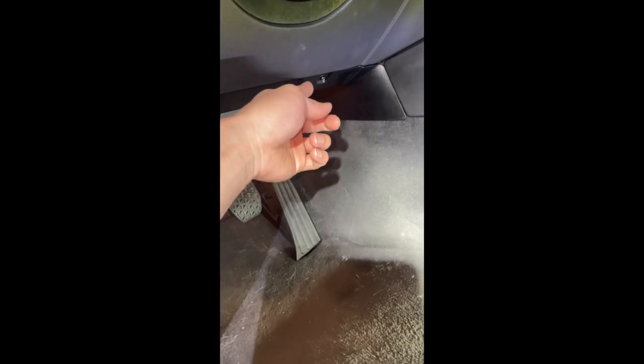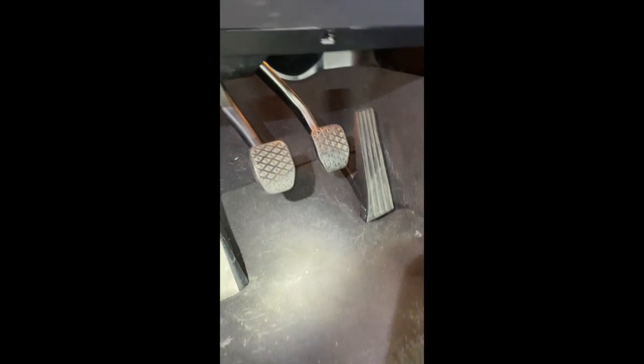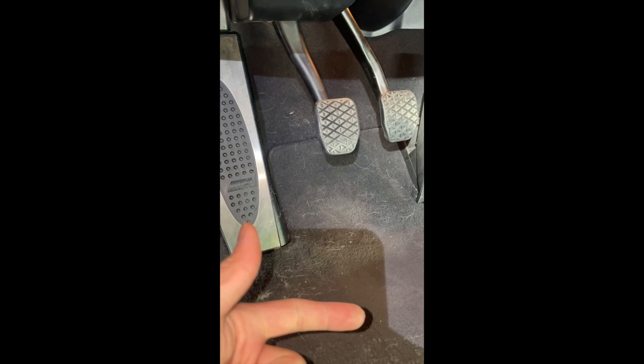They gave a really detailed instruction booklet here — it's a total of 8 pages. I have installed this before so I probably won't be referring to it as much. Basically all we have to do is take 3 screws — I think they're T20s. You'll have 4 connectors inside, which may differ with different car options. Then you'll have to remove a lightweight spring and an over-center spring. And lastly, there's an E-clip that connects the pedal to the pivot shaft.